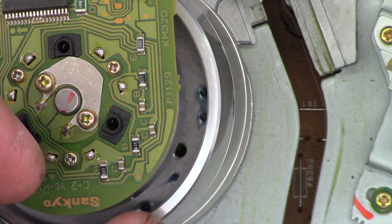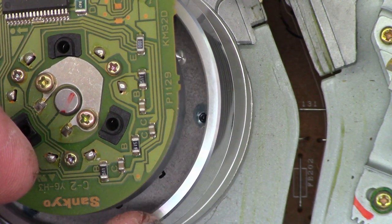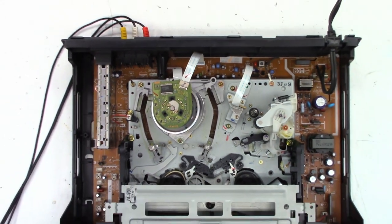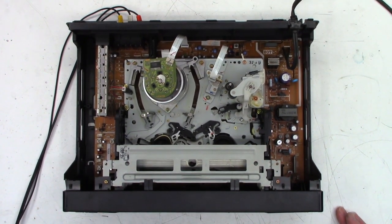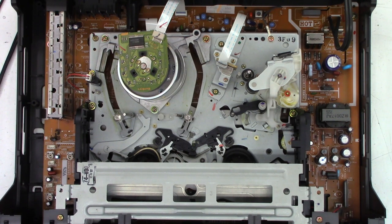Actually, I have replaced individual heads on a cylinder years and years ago when my eyesight was better, and made a very bomb VCR, Dolby Stereo Linear Tracks, 58 micron SP heads with hi-fi stereo. I couldn't find any 58 micron hi-fi heads, so I had to just go with the 38s that they had, but it worked absolutely perfect. It was like duplicator quality tapes that I could make on this thing with both hi-fi and linear stereo.